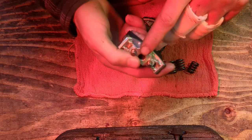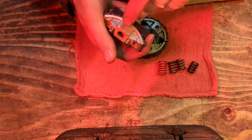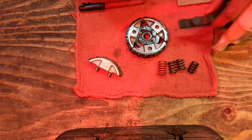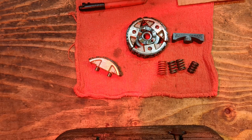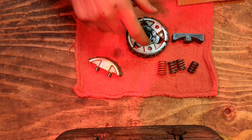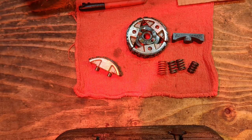Like I said, I'm sorry I haven't tested a stock shoe set with red springs but still having holes drilled in the side. I really think the holes in the side are the winning ticket to keep the oil clean and the grime out of the spring surfaces. So Anna has put maybe, I don't know, 10 or 15 or so hours on these red springs, and it's been a consistent clutch engagement the whole time, assuming the oil's clean.